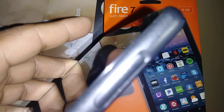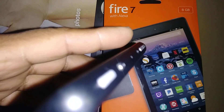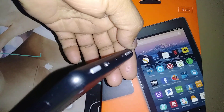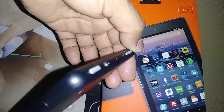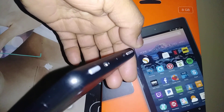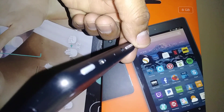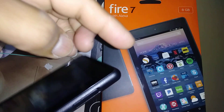This is a factory reset, so everything is going to be deleted on this tablet. Start with the tablet off and at least 30 percent battery charge, or leave your charger connected to make sure it has enough power. You're going to use the volume down button, which is on the left side of the tablet.